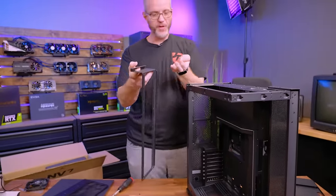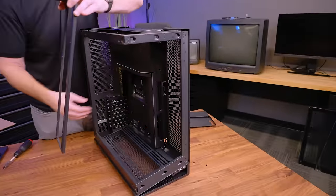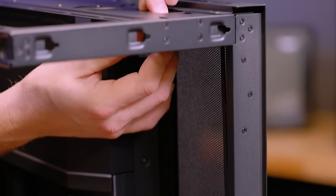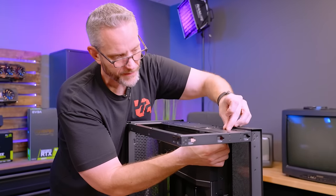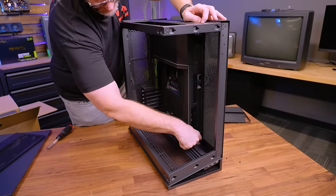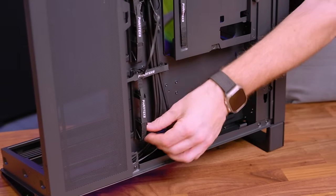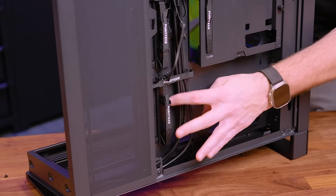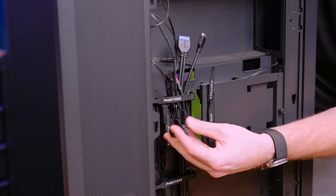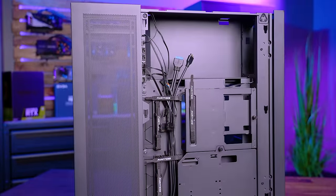To access this cage, there's a thumb screw on the top right here. Then you can mount your fans and your rad to this — they all have to go on this side though, because we've already shown this is right up against the rear of the chassis. You just line up these two tabs with the two slots in the bottom of the bracket, just like that. Put in the thumb screw and then your rad and everything would be in there. Having that front panel off is nice because you have all this access. There's some grommets down there and a wire channel right here — this is where all the front panel connectors go through. In terms of cable management, you've got plastic tie downs with Velcro over them, three channels total. You do need some SATA power cables — they require two SATA power cables to operate both the front panel and the ARGB divider.